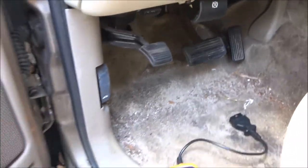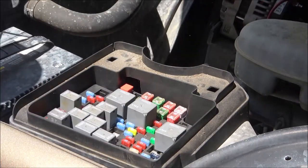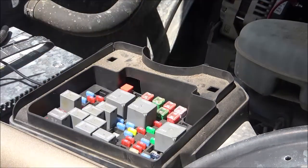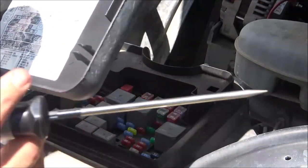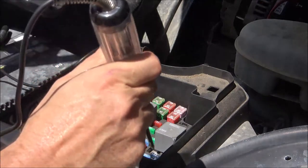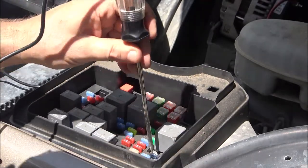I know she said she's had it scanned before — that's how she knew the O2 sensors were bad — but right now it's not reading anything and I know it's not the scanner. Let me check the fuses. I have the key on. This is an '03 Chevy Suburban — these work through the cigarette lighter. The radio works, I know everything works, but I'm not sure about the cigarette lighter. I can see it's blown.